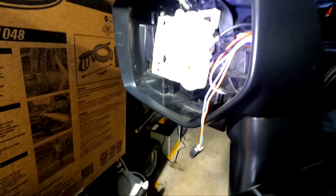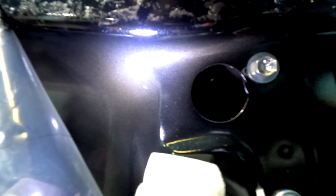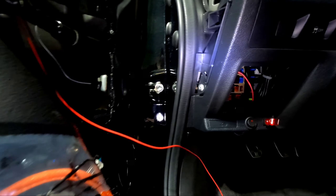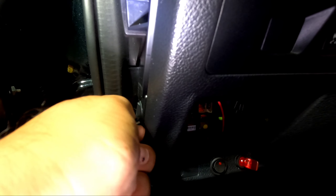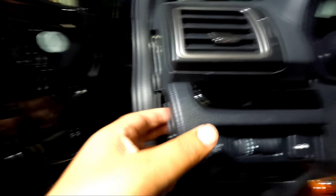Once you finish connecting everything up here, set the mirror back up, put the rubber grommet back, and bolt everything up — three bolts. Now I'm gonna show you how this is going to get very easy for me because I already have other lines running to the fuse. Let me take this screw off here and show you what I mean. Once you get this screw off, this entire face plate comes off — you can see where all your mirror sensors and your trunk release button are. Hold right here, pull that piece off, and this just comes off with a nice little tug.